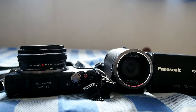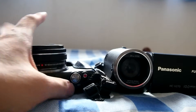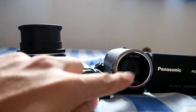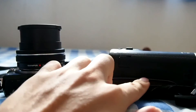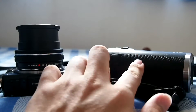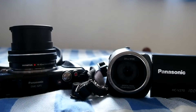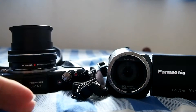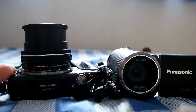The next example is the zoom lens. Most camcorder lenses are actually built into the body, whereas on cameras the lens is external and sticks out when you zoom. With a camcorder, the lens stays inside. In order to fit the lens inside the camcorder, you need a very small sensor so the lens can fully fit, and with a smaller sensor you can also fit a much longer lens.